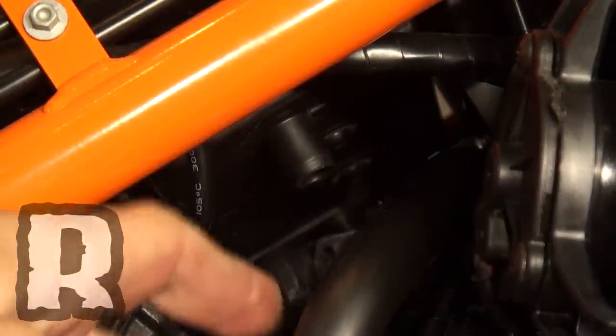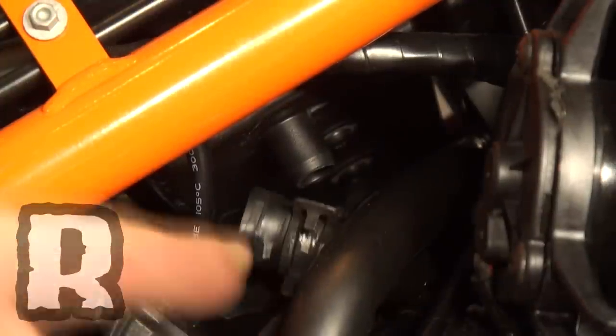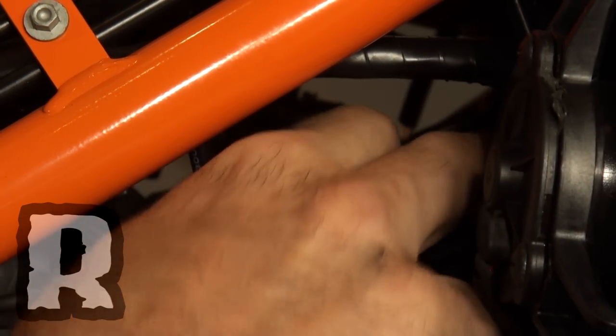Pulling the air box out from the top you'll notice a little bit of resistance, so we're going to pull that off just like that. And then underneath that, when you pull up the air box, you're going to find the SAS valve is sitting on a rubber, kind of a staked rubber mount. And if you reach in there and just hold onto it, you can pull the top of the air box off just like that.